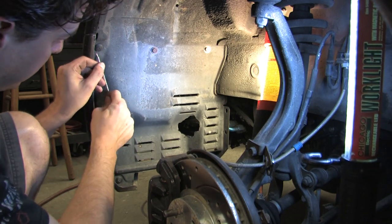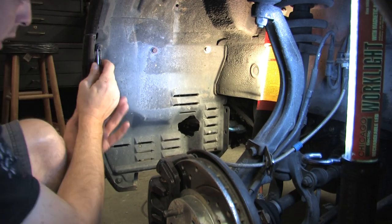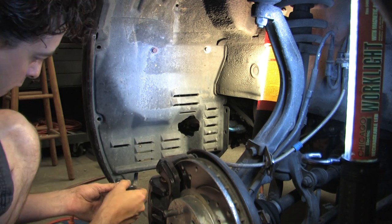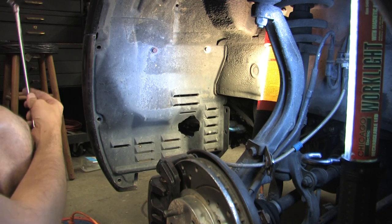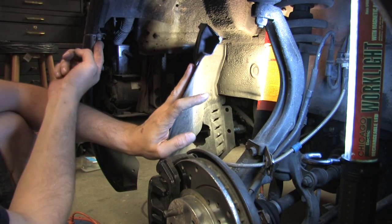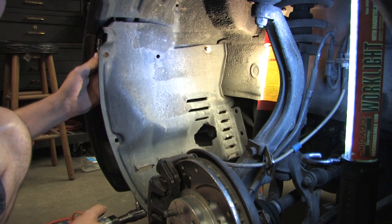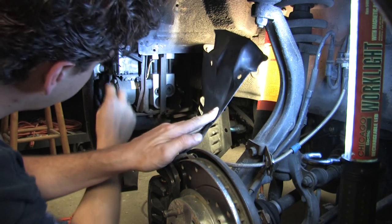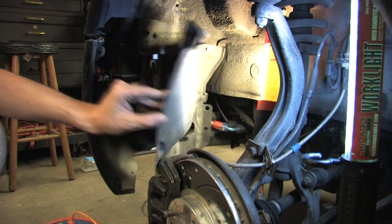Sometimes it's good to have a pick. Sometimes the fasteners come out bright and easily — when that happens, you just do that. These are the fasteners that take off the front bumper, and there's another one right back here. You don't have to crawl up in there with the tool. Now you just have to take your light bulb out — the signal blinker. And that takes care of the front bumper. That part's loose now. Just do the same thing on the other side.